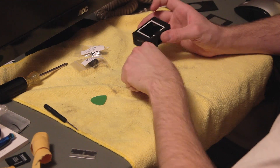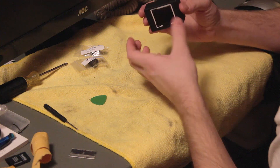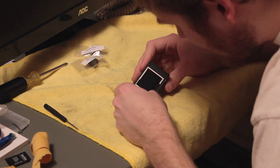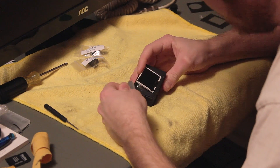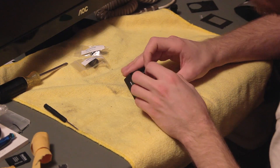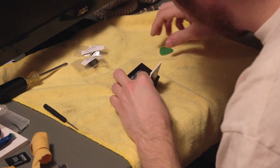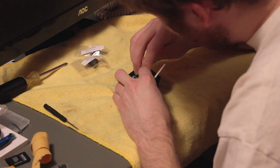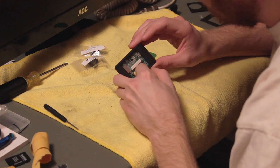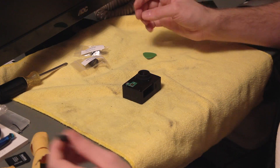This little light pipe here will fall out, so be careful about that. Now this is the tedious part — you've got your screen, so you want to be really careful. The razor worked well to get that separated. There's a flat flex cable with little tabs that you pull out to disengage. Gently pull that away and set it aside. Now we're basically ready to take this thing apart.